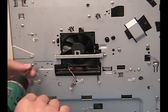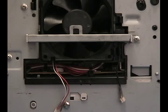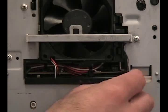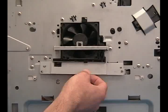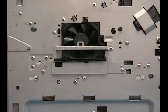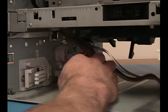Replace the three mounting screws on the other side. Plug the fan cable back in. Plug the sensor cable back in. Reinstall the shield. Snake the cables through the cable guide, starting with the smaller red ones.